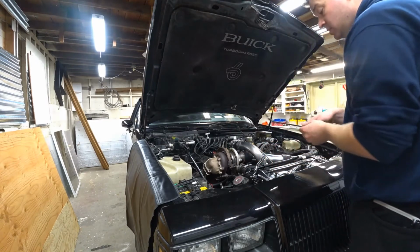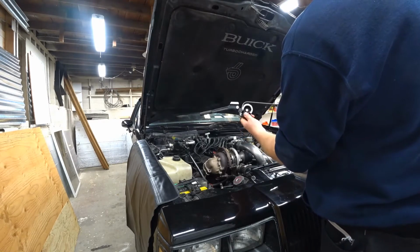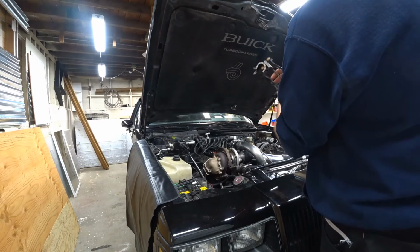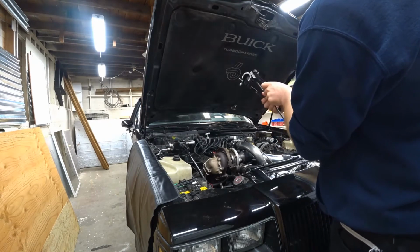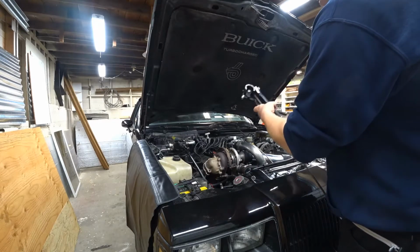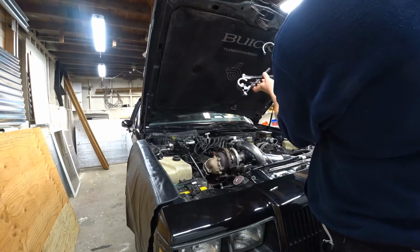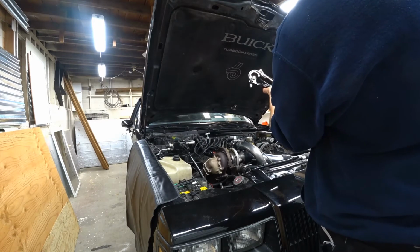So I'll stick this tube back in here in my bender, make sure that nut's where it needs to be, close this back up. You can see it closes right at 90, right where it was. And so what I'm going to do is go to about 145 degrees. This thing will do a full 180, but it doesn't need to be that height or that tight. Maybe I'll hold this up for comparison. I'd say that was a damn good guess. That's 145 degrees, give or take. And that's looking pretty good.